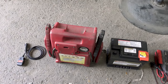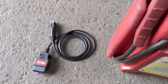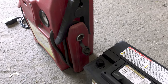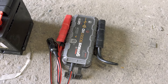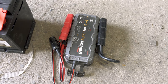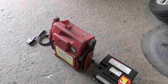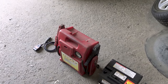I have a standardized jump box with a battery inside and a special cable — it's a very cool cable to have. What it allows me to do is plug into the OBD2 port and then plug the other half into a cigarette lighter. I normally use the cigarette lighter of my jump box. The modern smart jump boxes sometimes turn off the 12-volt power source automatically — they time out, which is no good for our situation. This old-school style jump box, which they still make and sell, doesn't turn its 12-volt cigarette lighter output off, so it stays on all the time.